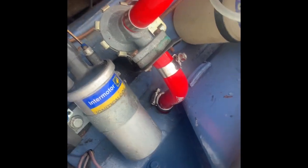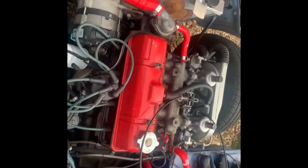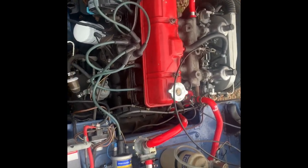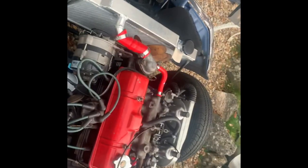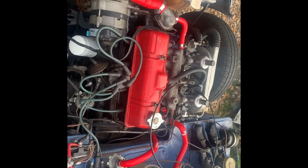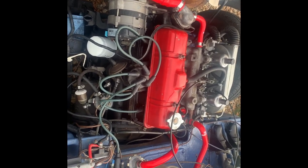Alright, all together now. At this point what you'll do is clean up any spilt coolant, because the next thing you're going to do is fill the radiator up, and then essentially what this will mean is that we can tell if there's any leaks, and that's what you want to be looking out for really. And if you can see, Eric seems to be happy with the work.